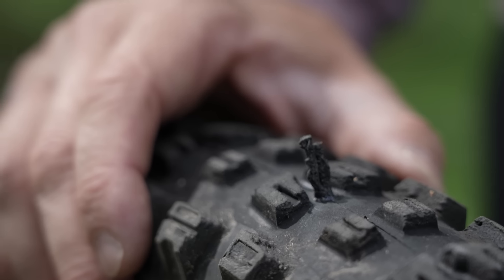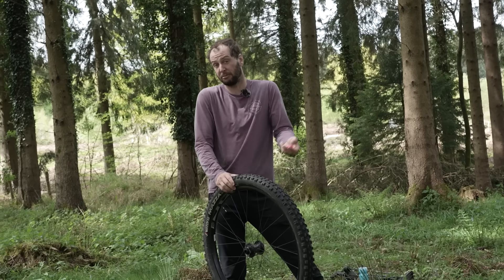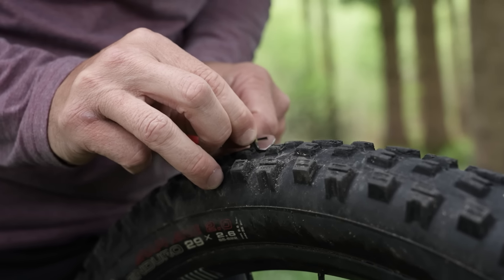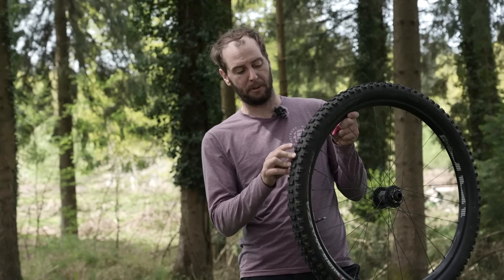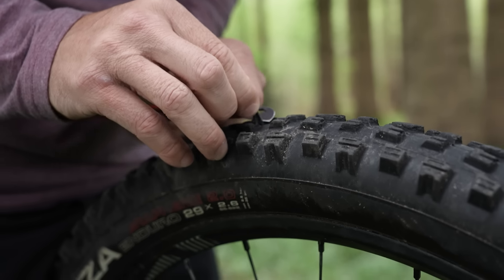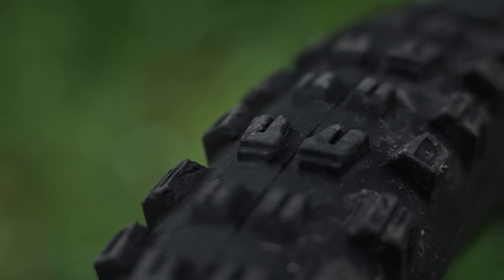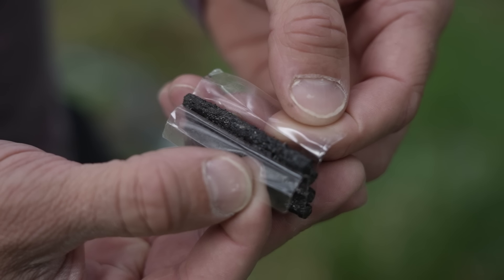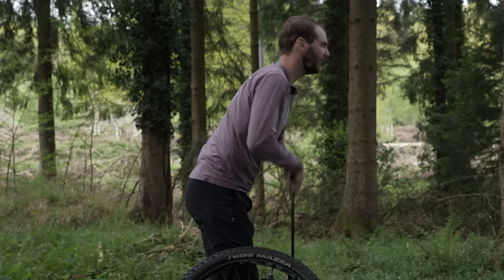You'll have two little tails poking out the top. If you've got a small knife, snip off the excess — not flush to the bottom, but really close down just below the tread. If you leave them long, the cycling and braking motion will drag and pull the plug back out. Trim it down and that tire is pretty good to go. For really big holes, use the larger, thicker diameter bacon strips. I've had it where I've used two or three pieces and just had to persevere — then pump it back up and off you go.